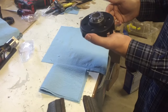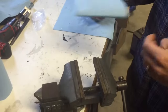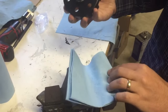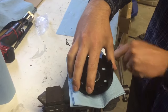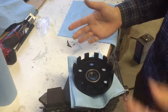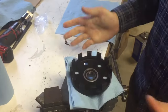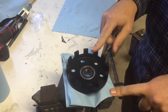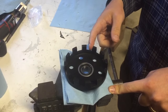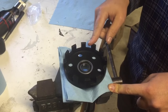The first thing you want to do is hand tighten the sprocket — it doesn't have to be too tight, but you want to seat it. Then take a shop rag, put it into a vise if you have one, and reposition the basket to loosely grab onto the teeth using the vise. Then hold onto the basket with your hands and tighten it as much as you can by hand. The amount you can torque it by hand is sufficient to get you going. The first time you accelerate on the bike, it will tighten the sprocket in the clutch basket to the appropriate torque level.